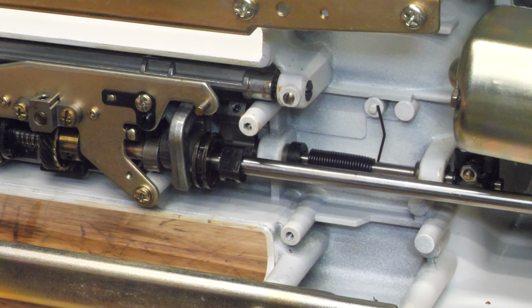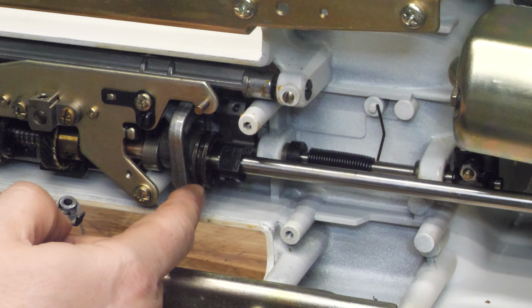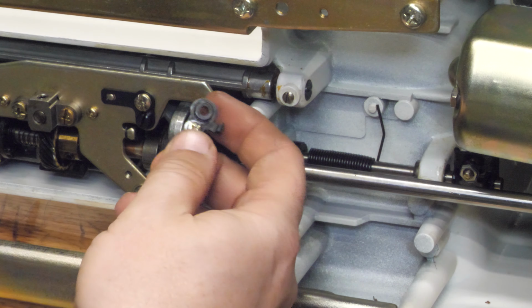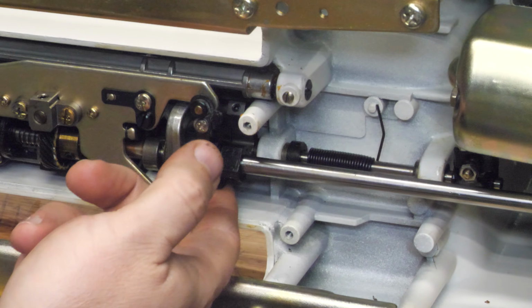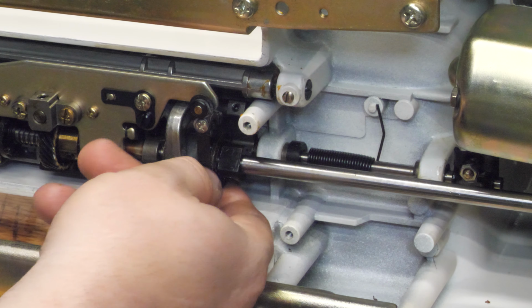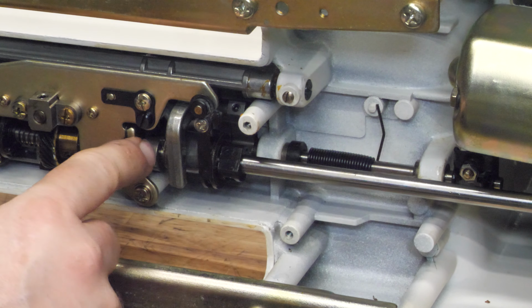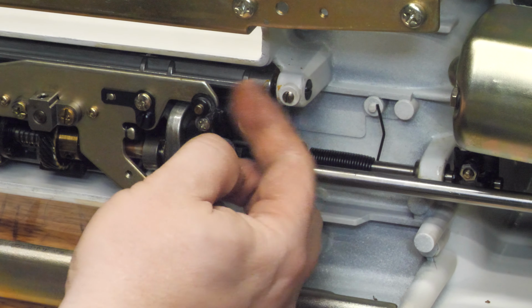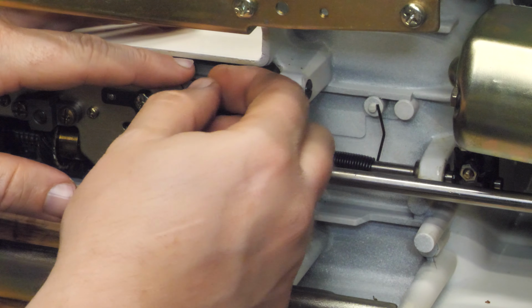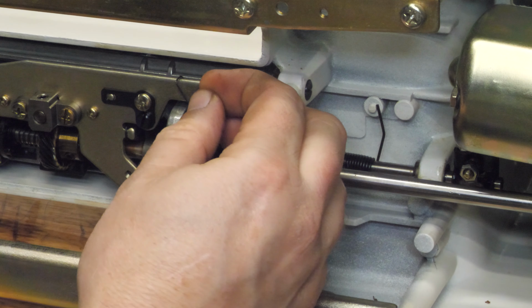All this stuff is thoroughly degreased, so you need to make sure and rotate this around until that metal clip that rides in here is centered. That lets it travel and then holds it as it presses to interlock on either the dogs on either side of this part. So make sure that's in there, and then we'll put our spring in place, and we don't have to wind that up until we get our washer and clip back on.